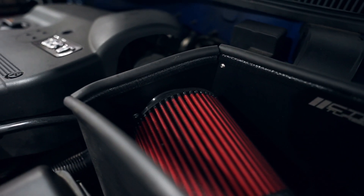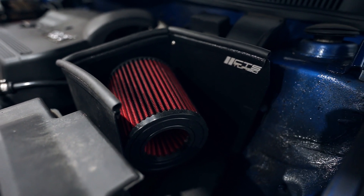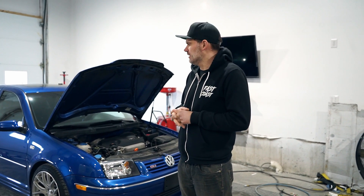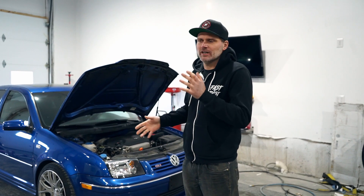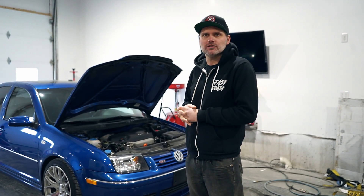Engine-wise it's stock, but it does have a chip tune — I think this one's running Unitronic. It would be considered their Stage 2, so it has an upgraded downpipe, an intake, and I think the diverter valve has been changed. Unitronic Stage 2 files are typically 93-octane files, but we're only running 91 octane here, so it's probably going to make around 185 or so. They typically dyno anywhere from 180 to 200 depending on the mods. If we see around that for power, we know the engine is good and healthy.